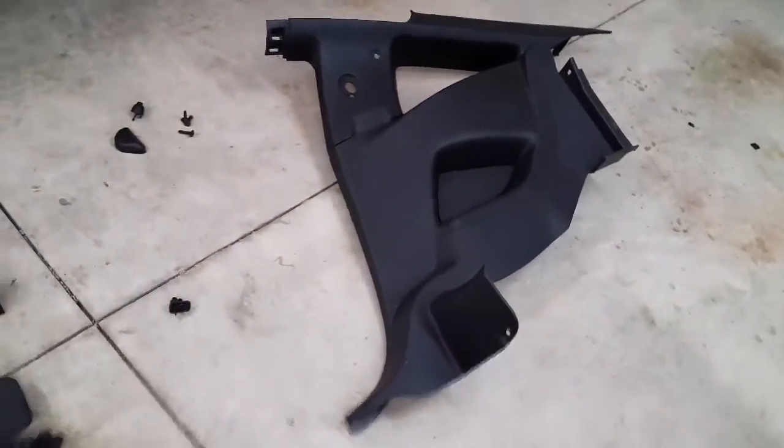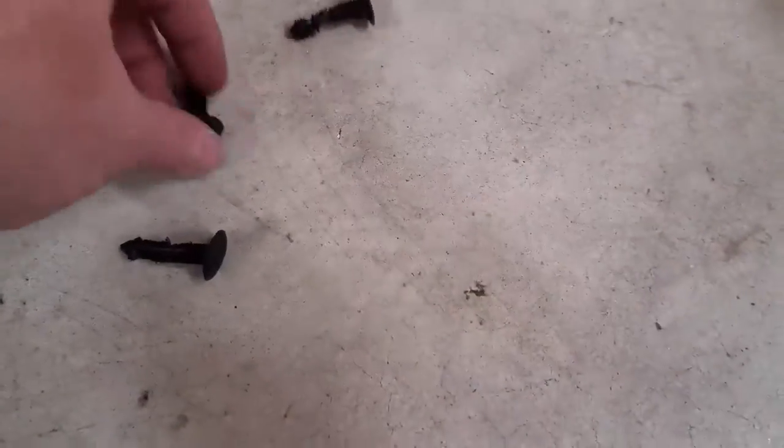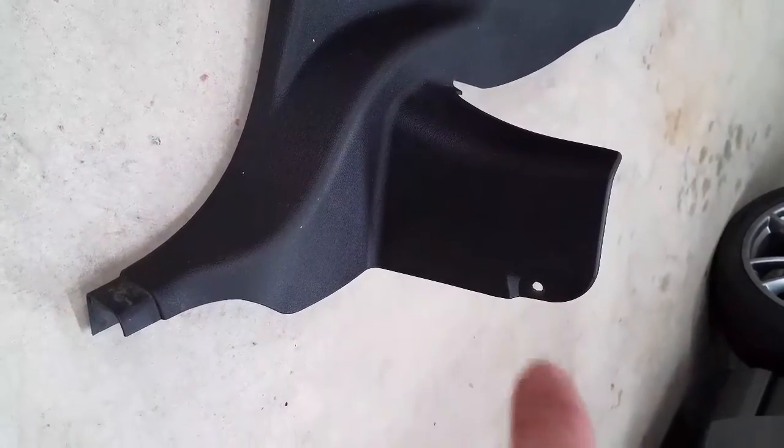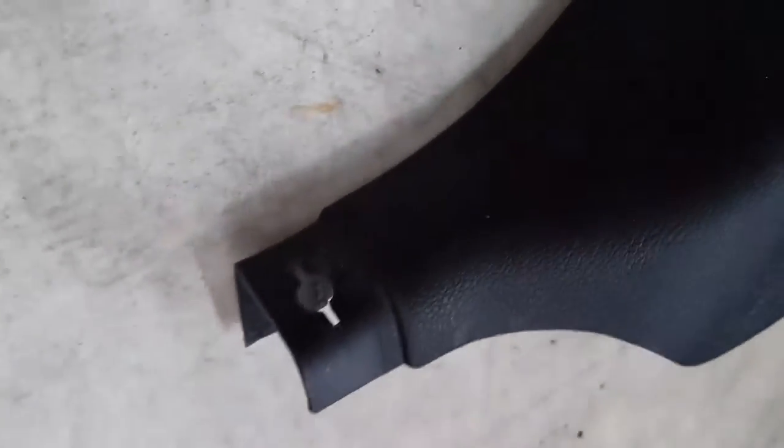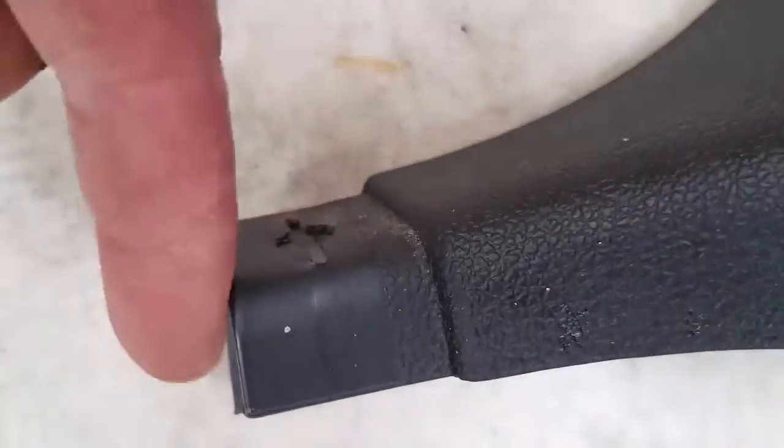This is going to be the passenger side, but same principle. This whole trim piece needs to come out — it's really pretty straightforward. There are three little pop fasteners that need to come out, with a hole down there where the floor would be. Passenger side sill plate, step in — this is your floor, your seat and seat belts up here. Take one out and then with your seat folded down, you'll be able to find the other two. A trim removal tool is nice, but a putty knife or claw hammer will work in a pinch. Once you get those out, then you're free to mess with the sill plates. The sill plates need to be pulled up a little bit on each side because there's a plastic tab that goes down and engages.